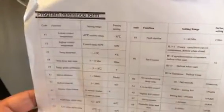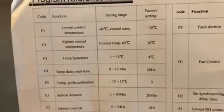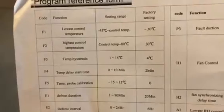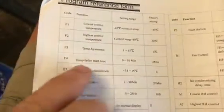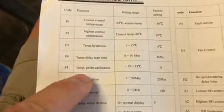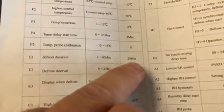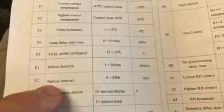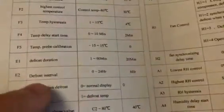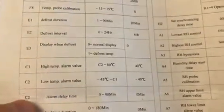Here's the function menu or program reference. F1, F2, F3 is your temperature hysteresis - I think that's the lag time or the value deviation before the controller kicks in. The factory setting is four degrees and I've brought that down to one degree. There's a delay start where the controller takes two minutes to kick in. I've changed that as well. The calibration I left, then there's defrost duration - factory setting is 20 minutes, and defrost interval is every six hours. I changed that because I don't want the fridge stopping for 20 minutes every six hours.